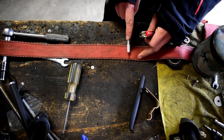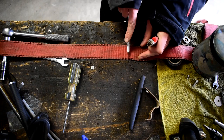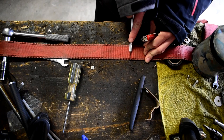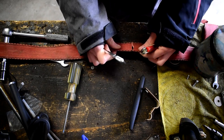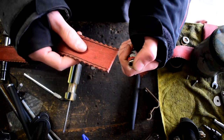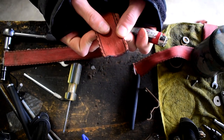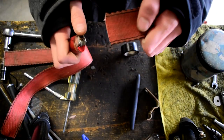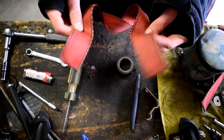The blade should be hot and should be able to cut right through. It's also easier if you have someone pulling on it to put tension on the line so it cuts through more easily, and using a sharp blade will help too. We're going to go ahead and cut through, then singe the end. As you can see, that's nice — it's all one piece. Let's go ahead and hit the other end so the rest of the strap stays nice and together. Now we've got our strap.